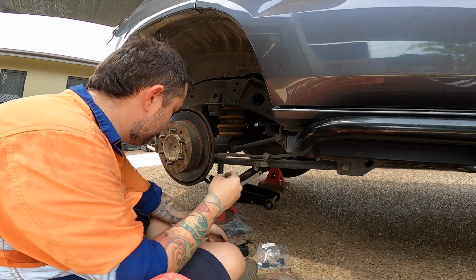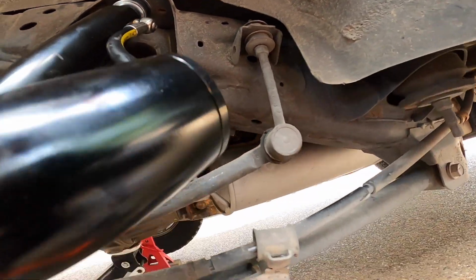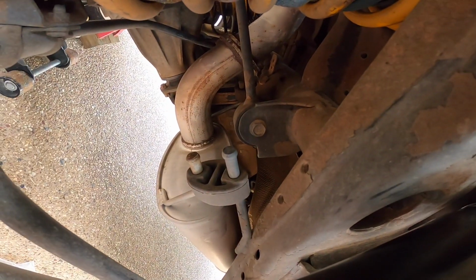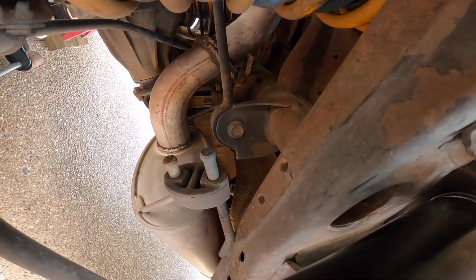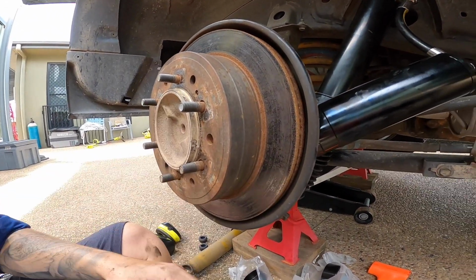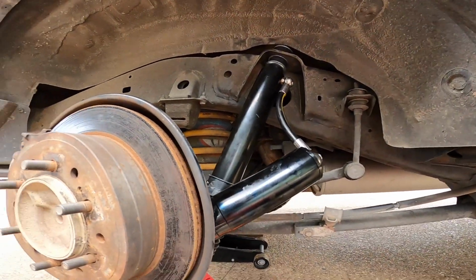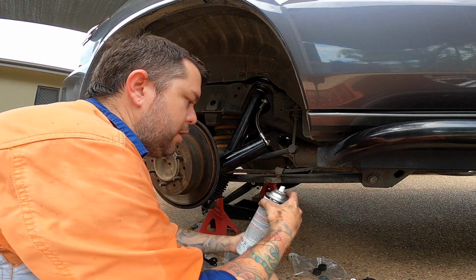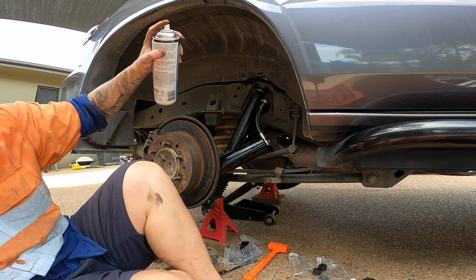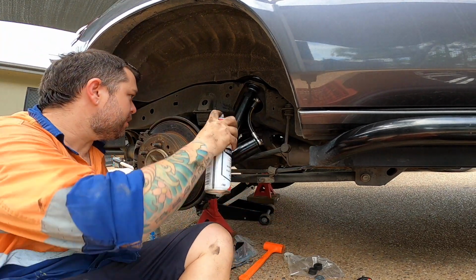18mm for the top nut. So after a bit of research online, there is actually 2 holes up there. There they are, under the chassis there, already there. And these bolts, well, one of them is meant to go in there with some washers and a spring washer. Obviously they're full of crud, so I'm just going to try and clean it out with a bit of contact cleaner. You use the rear hole, apparently. This is not going to be easy. Clean, and then a bit of CRC.